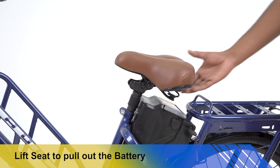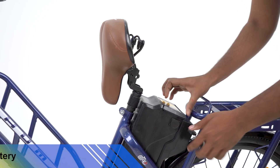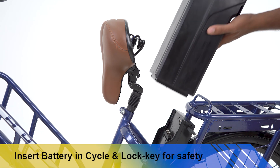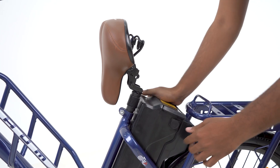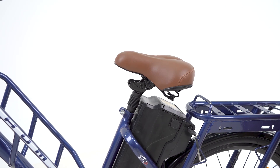To take off the battery below the seat, look for the blue head lever. Pull and simultaneously uplift the seat to unlock. Pull the battery up from the case to remove it. While inserting the battery, check for the case alignment and insert the battery. Push the battery gently from the top to get connectivity of power, then lock the battery.